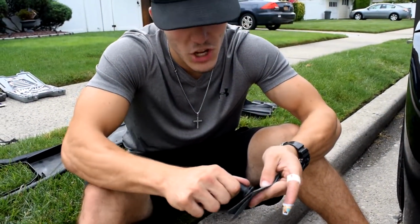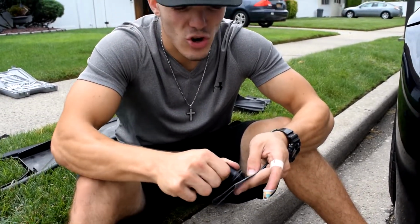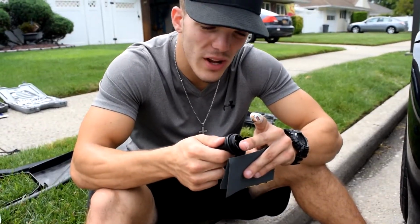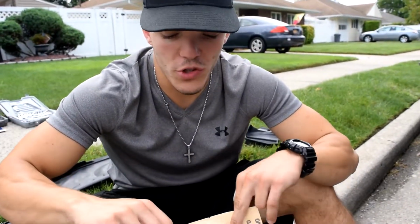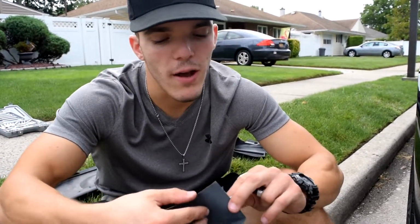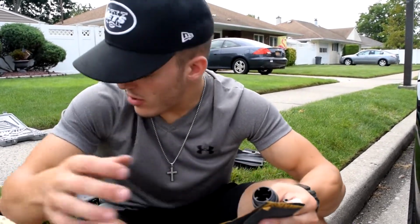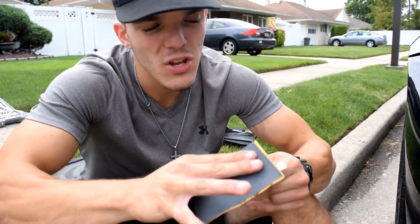But the sandpaper is definitely a safer way to go, but you might need a knife to start it off, because if you use sandpaper for the whole piece, it's gonna take you a while. All right guys, I'm gonna recommend it again. Sandpaper is definitely the way to go. Start off with something coarse, like I have 150 here, and then go down to something really fine. I don't even know what this is. 1000, wow. So I started off with 150 and did a quick jump to 1000. It doesn't really matter how perfect it is, but now the sanding is all done.